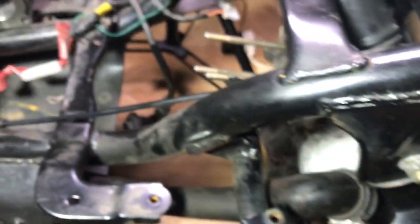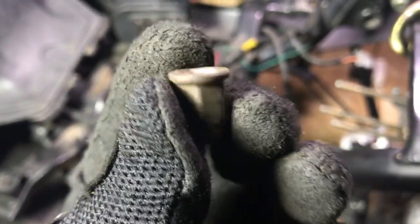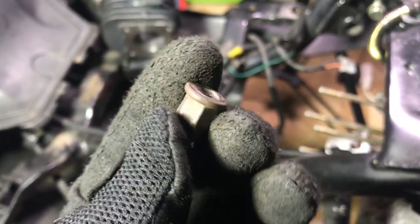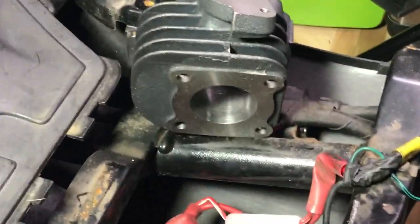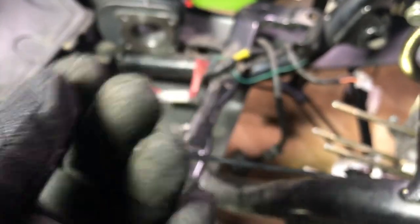Now I have to call them again and see if they have those in stock. I'm probably gonna take this cylinder to them and say 'can y'all install them on it?' because I'm not trying to ruin the other one. The other rep said they do have the bolts in stock — less than 10 bucks — and to bring the cylinder in so they can match me up with the correct bolts. He also said, honestly, I might be better off just installing bolts that go into the exhaust rather than studs that stay stuck in there, because if they vibrate loose that's better than breaking off in the cylinder.